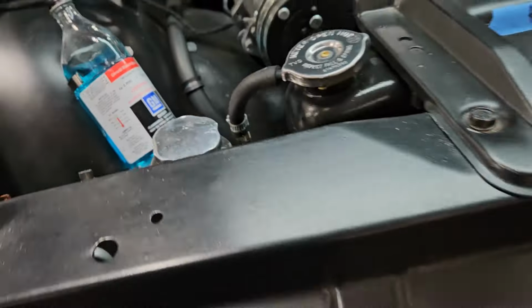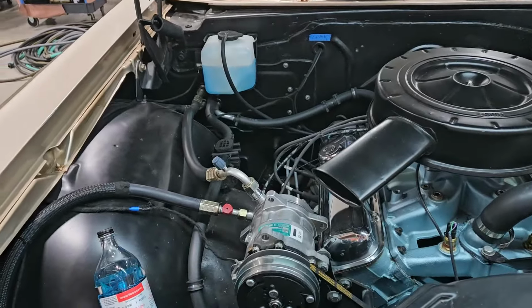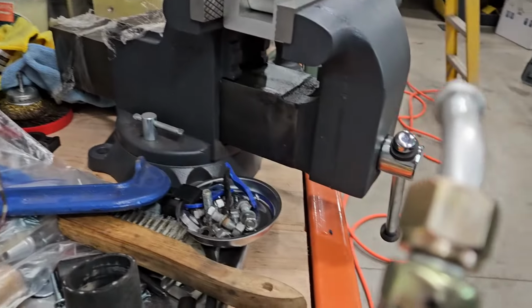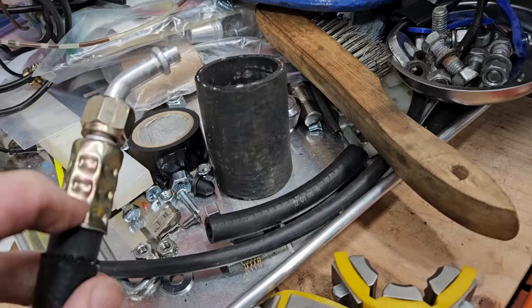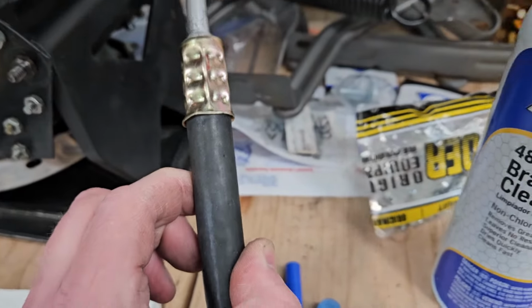Oh boy, we ran them through. Oh, that's going to be fun to get them out of those. And, okay. Well, is what it is. Okay, as I'm working, two things I'm looking for. One, every one of these has a little sight window, which may or may not focus, to make sure the hose is in. And the other thing is the depth of the crimp. So you can see these have re-crimped, and that's the depth.